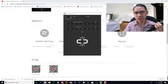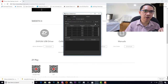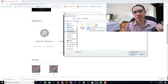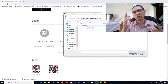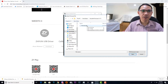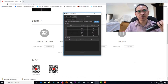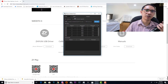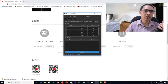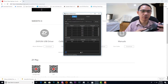Now I've already browsed the firmware file, but you just have to simply click on file and select the firmware. The current version is firmware version 1.77. Once you've selected the firmware file, click open, then click the upgrade button at the bottom and click upgrade until it tells you that the firmware upgrade was completed.